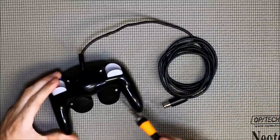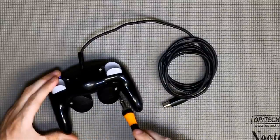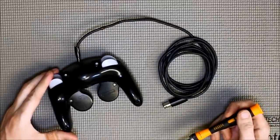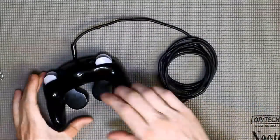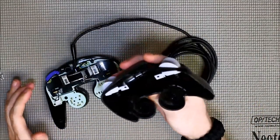Let's get on with taking this thing apart. You've got six screws — two up top, two in the thumbsticks, and two at the bottom. I'm going to go ahead and remove those screws and get this controller taken apart. Alright, so the screws are out. Now we just need to lift the back off. Pretty easy — there's not much to it.